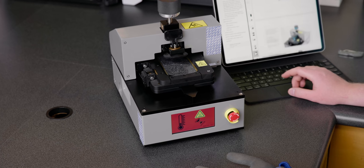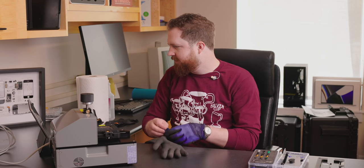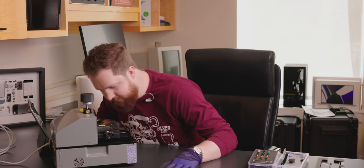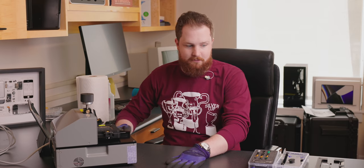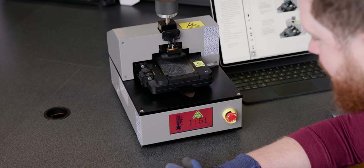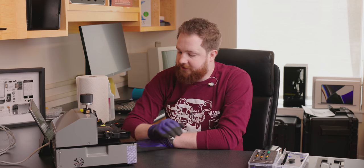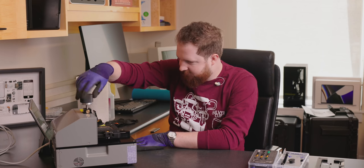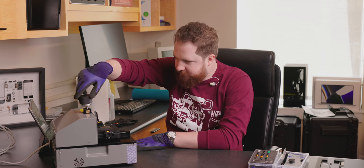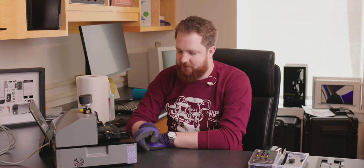It takes two minutes and I'm guessing the temperature readout is just based on time. The fan curve on this thing is unbelievably weird. With about 20 seconds left, I need to lower the cup almost to the bottom, slide the suction cup up, align it with the display, tighten the suction cup, and then slowly twist in the opposite direction to pull the display and chassis apart. It says if it doesn't happen immediately, wait 30 seconds — probably to heat-soak it.